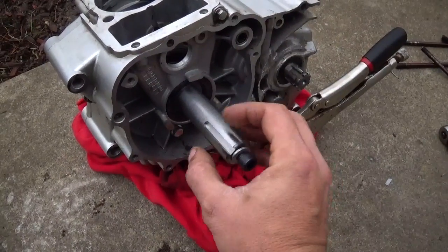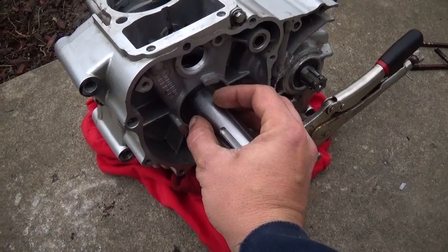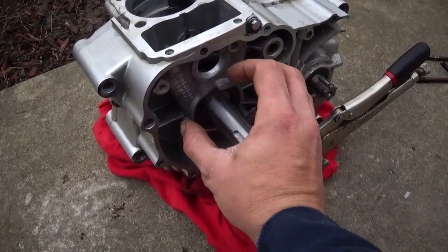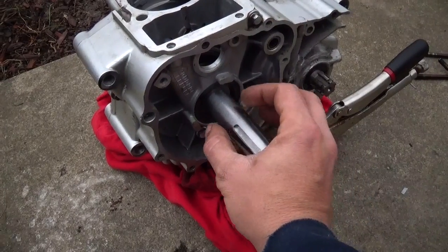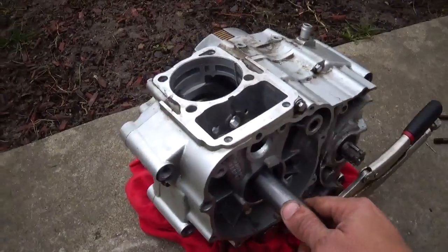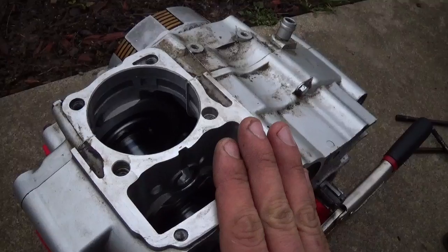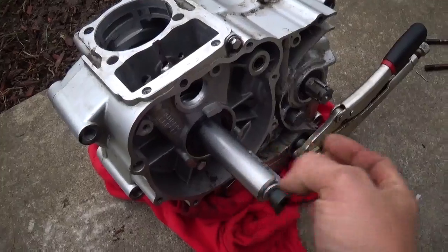And what I'll do is I'll put the seal in the ring, and then slide the ring down on, and then tack weld it, and then remove the seal, and that'll make it so that the ring is centered, because the seal will be making it centered. Probably won't put the seal all the way down in the ring, just to get it centered. Tack weld it, and then take the seal out, weld it all up, and then I'll just trace out the head gasket to make a cover for this, and then just bolt a cover on it. But well, we'll make the covers.